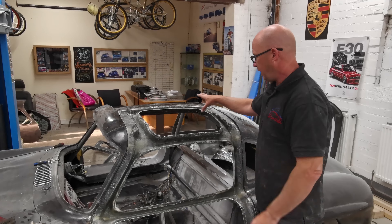So what we've got here is an Airlift management system. As you can see, these are the pressures of the bags — rear bags right hand side, left hand side, front left, front right. I can adjust these individually. If I want to put more pressure in the left, I'll press that button — you can hear the air compressor kicking in now. These buttons here are set buttons, so I can set these to whatever height I want. For instance, this one here, if I press it, it will set it to 50 on the front and 75 on the rear.